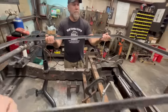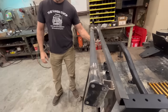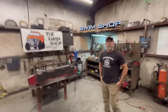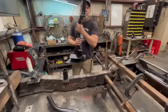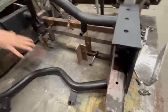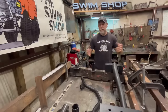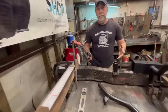This is what we built to simulate the leaf springs on the van — these simulate 47-inch square body leaf springs. It basically turns your van into a square body Chevrolet truck. We tried to build it so you could go buy off-the-shelf parts if you wanted to change something up. The engine cradle bolts down and also provides another tie-in to tie the two frame rails together — they're unibody, so any extra tie-in helps.